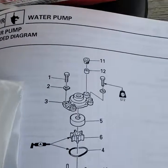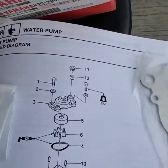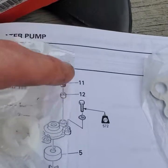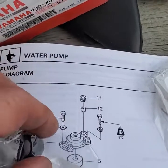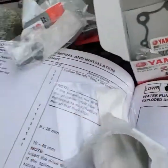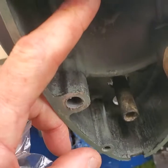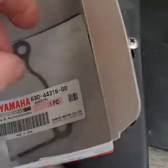As you can see, the bolts come with it, the wear cup comes with it, the impeller comes with it, and the wear plate on the base comes with it. You have the upper plastic guide piece that's up here in the picture. You also have the rubber seal — that's really important, it's up here in picture number 11 — and that accepts the water tube. That grommet fits right over there when you look up in here.